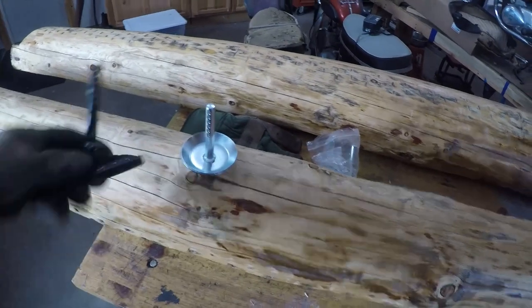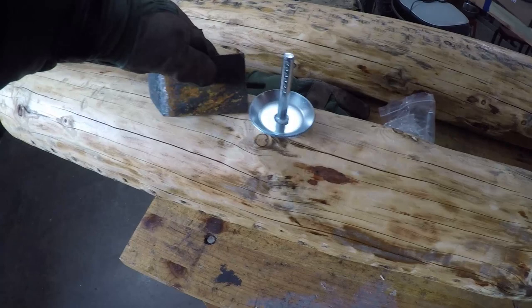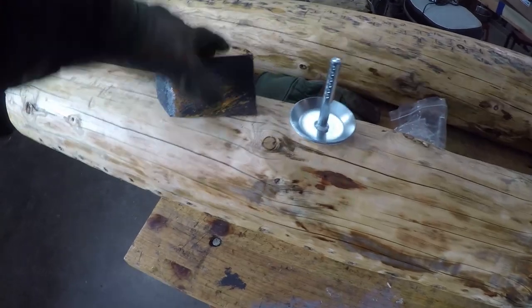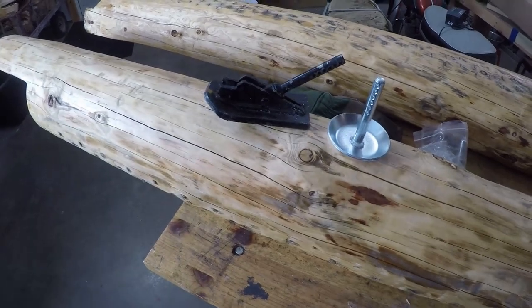Also, just for fun, I took one of the stems that wore out on an old unit, and I just welded up a couple of skis instead. This worked okay, and the idea was, as they wear out, you can just put some weld beads down here to slide on instead of having to buy these things all the time. So they work pretty well, but they stick out in front of the cutting edge, so you can't get down to the ground with something like that.